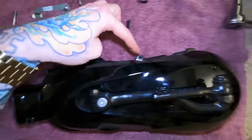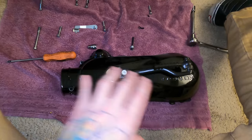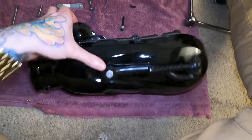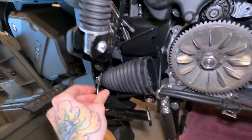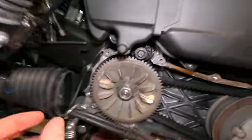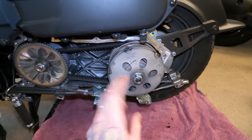Taking it off was fairly simple. You just have eight bolts that need to come off around the cover. I've seen a video or two of somebody taking this off and they took off the kickstarter, but that didn't seem necessary — I didn't, and it still came off. You also have to undo this clamp right here and slide it down so this little tube comes off, then kind of wiggle it down around to get it out of there. And then this little cover will pop off also.